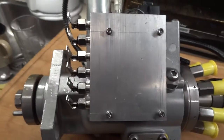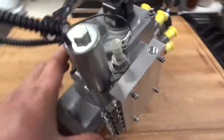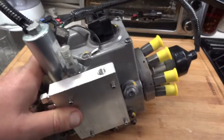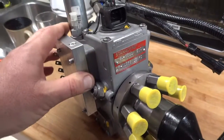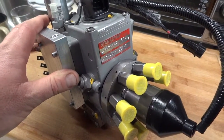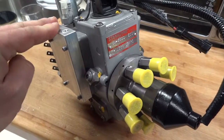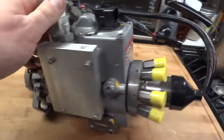It works fine with six glow plugs. The heat-up time is about two minutes, so with this on the pump it takes two minutes to bring the whole pump up to 100 degrees. Once the pump reaches 100 degrees, it is safe to start on 100% veggie — that's the purpose of the heater block.